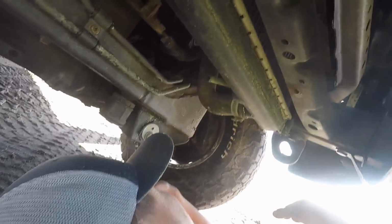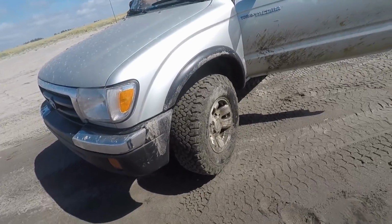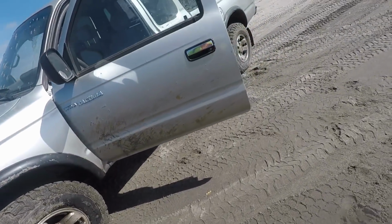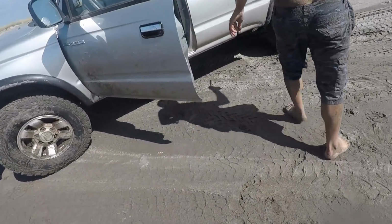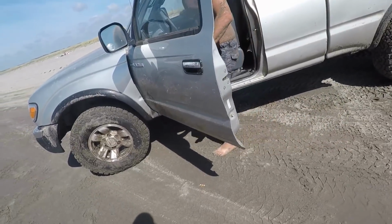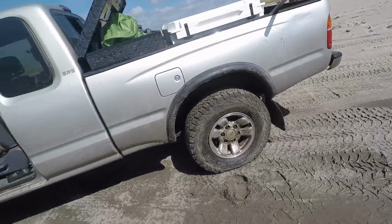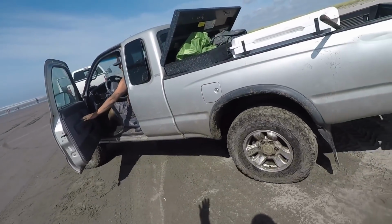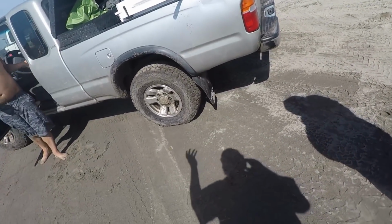Okay, now if you touch your brakes, it's gonna jam up. But as long as you don't, I think if you go forward now, do not touch your brakes. Michael, try it. We're doing a brake job. I can't imagine what would have broken that brake. Just try and go forward real easy, but don't touch your brakes. And don't trust that it won't slip on you and lock up. I wouldn't go any further than that. You've got a broken caliper. Now you can roll. The caliper broke and went into the wheel, so if you touch the brakes, it rolls right into it.